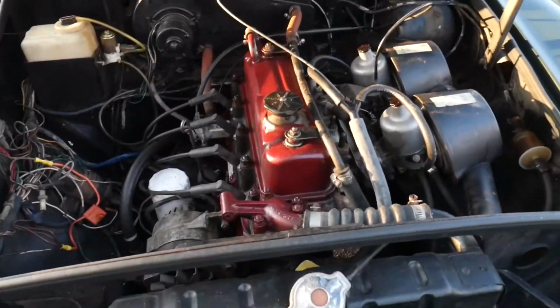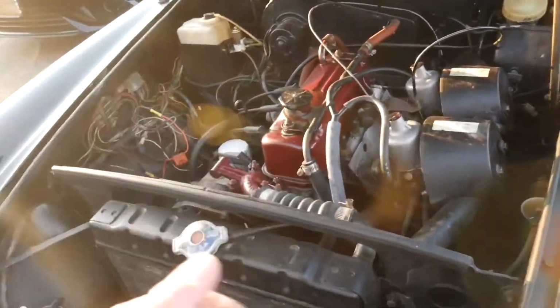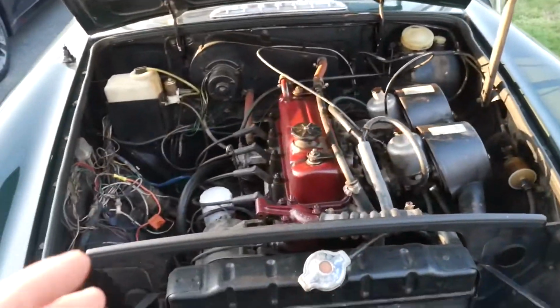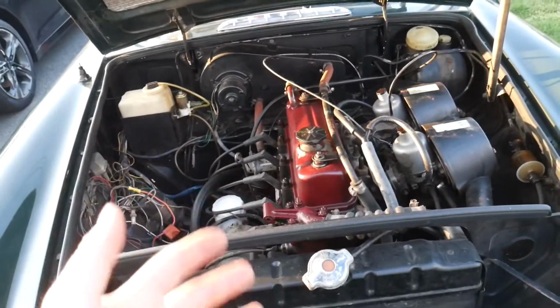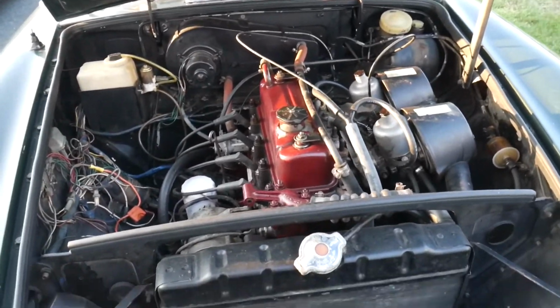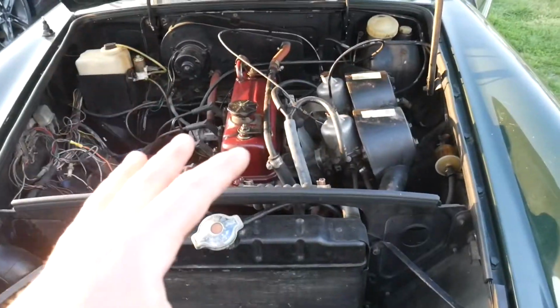Or maybe it's even the drain plug, I really don't know, but I can't take the bucket away because it's still pouring out. But while it's doing that, I do just want to try and spray some starter fluid into the intakes and see if I can even hear this thing fire, just so I know that I'm not going to be putting in a brand new gas tank for something that might be blown up or won't even fire. Just want to hear it fire, and if I hear that, then I feel pretty confident with this engine. I could do a compression test and all that, but I just want to see and hear if this thing will come to life for a second.